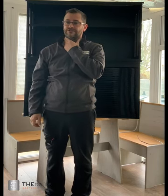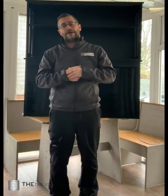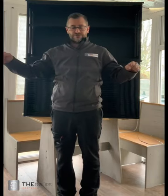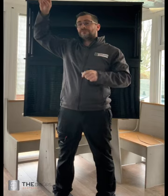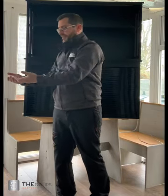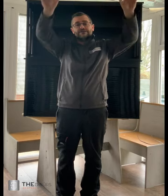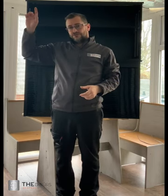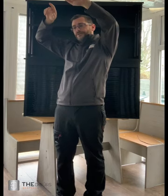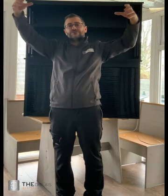So, recommended retail price. Obviously it's a universal option, so there's a couple of things to look for that mean it may not fit your camper van. On your sliding door camper van, as you slide across, you may have an arm that loops under your weather strip. If you've got a Sprinter or a Crafter, it doesn't do that. It just slides across on the mid-arm and closes, and your door closes up against your weather strip. Which is fine. On some models, and only a few, the arm goes under the weather strip, and that means you won't be able to tuck your screen into the weather strip because the arm will be in the way.